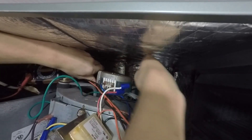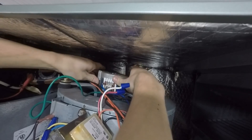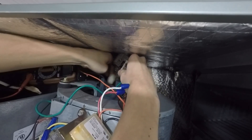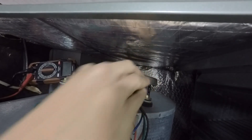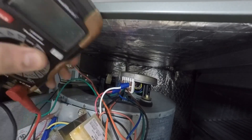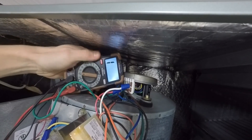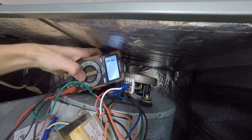Under the module portion there's going to be a cable with three wire connections in it. We're going to pop this up and you'll see this cable right here. You're going to unplug that and set your module off to the side. The next portion you're going to need your multimeter for. Set it to the lowest resistance setting that still reads 20 ohms — in my case I have 200 ohms, and that's good enough for us to see the resistance.